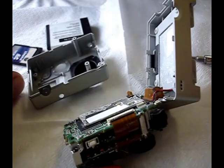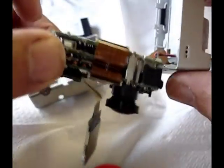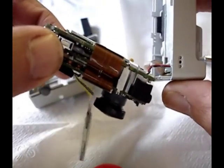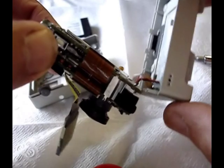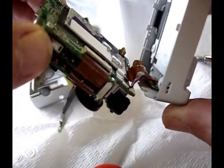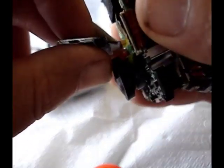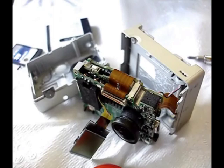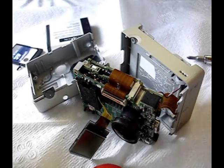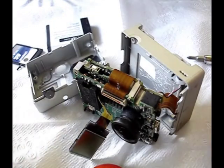I'll be honest — I didn't do it for three days. When I took it all apart, because it was covered in sugar water, I dunked this and all the electronics in really hot water and shook it hard for about a minute and a half so it would get all the sugar out. Then I held it in my hand and shook it really hard until all the water stopped seeping out. Only then did I put it in the rice — only for a day. This morning I did the hair dryer for a minute, put it all back together, and everything's working great.